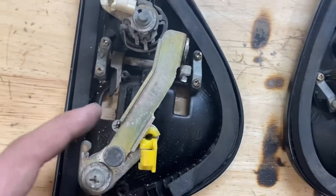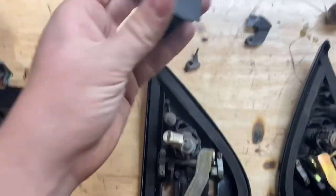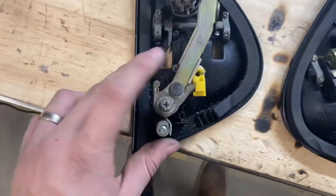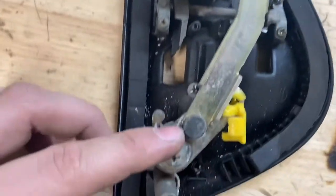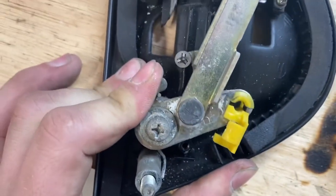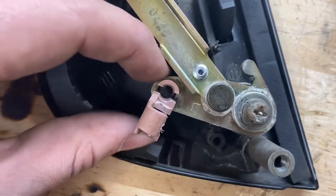The original door handles are plastic, so we're replacing those. Here are the bits and scraps from the old door handle. Geometry-wise, when the door handle opens, this rod gets pushed down — this rivet pushes against this bolt, making it near impossible to open until it breaks free and slides down. However, on this one I placed the rivet right there, which prevents it from sliding all the way up.